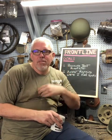Turns out that part of the lower radiator shroud was pretty much rusted out. It was no longer attached to the radiator. So I ended up having to remove that and refabricate a new piece of shroud. I did have a spare shroud, but I didn't want to just cut up a good spare shroud, and I'm good with sheet metal. So I fabricated a new one, and a new little mount piece that solders to the radiator, and that didn't take very long at all. So anyway, I made the repair, and today I plan on testing the radiator and repairing any holes I find.